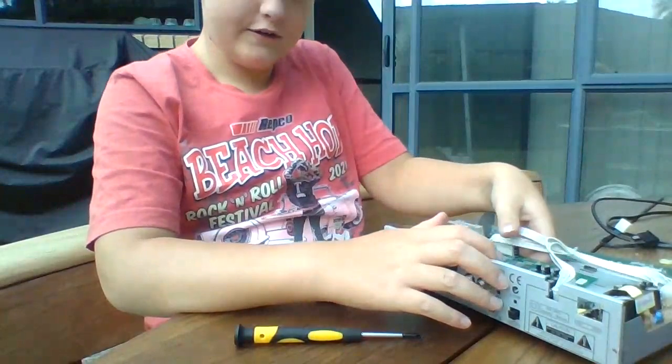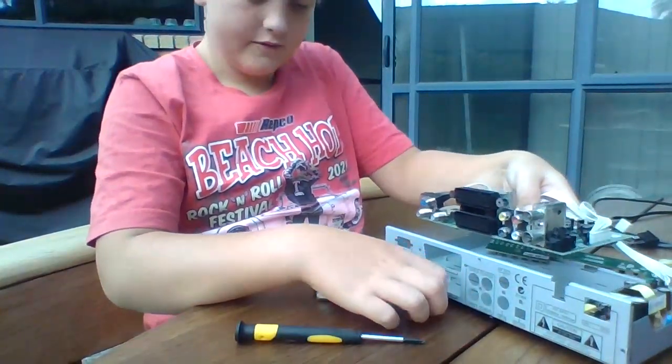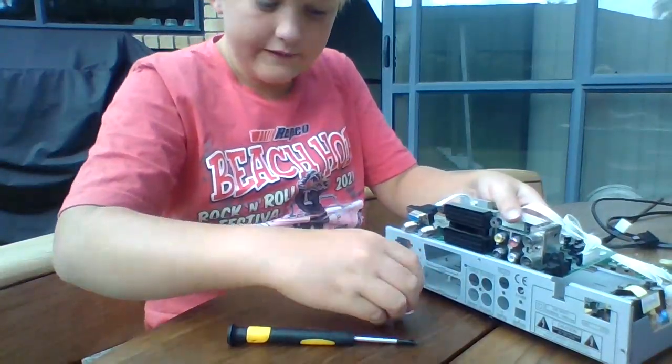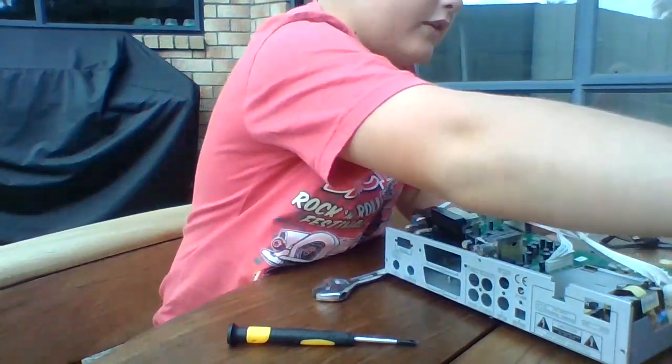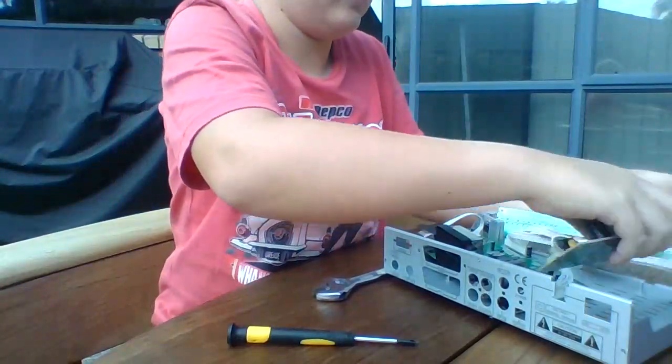Anyway guys, so I've got that out — you should just be able to push and lift out this board. By the way, when you're removing these two boards there are going to be two washers too, don't forget those. Now since we've got all the circuit boards out, we can just take all this out.